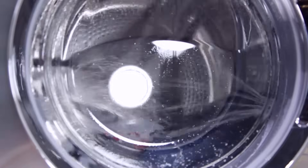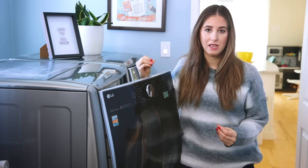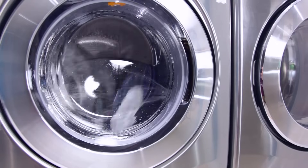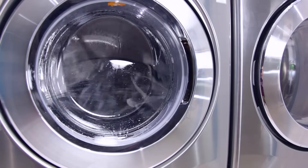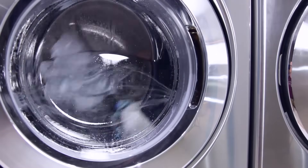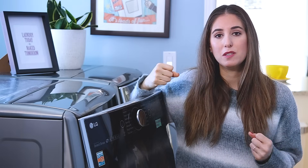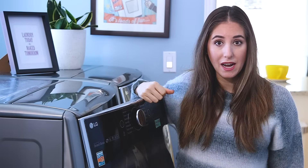The turning of the drum plus the action of the clothes hitting up against each other and the paddles is the mechanical action needed to start getting rid of dirt built up in your clothing. Once that's done, all of the dirty water drains out of the inner tub, and then the inner tub fills up with clean water. It then repeats itself so you get that clean water rinsing your garments. When the rinsing part of the cycle is done, all the water drains out, and then your machine kicks into high action and spins. The whole purpose of the spin cycle is to get rid of as much moisture as possible so your clothes can dry much faster.